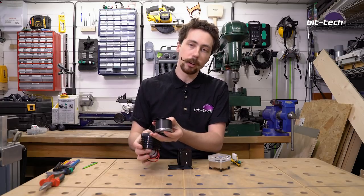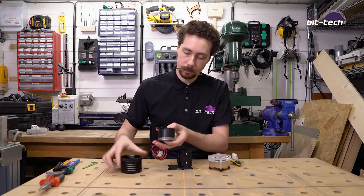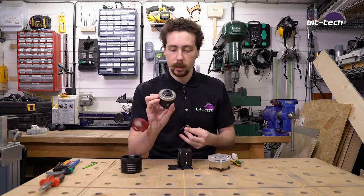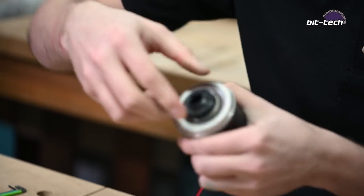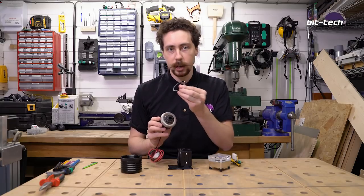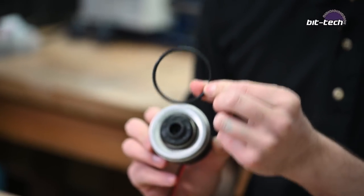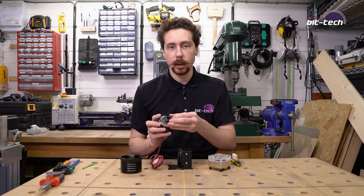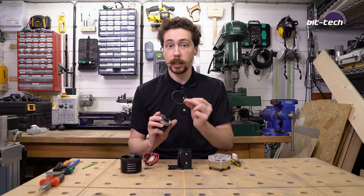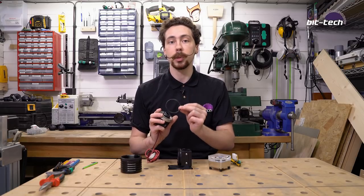All this housing here is primarily an aesthetic feature — we'll try and bundle the cables through the hole there. This is the pump itself and you have an impeller which connects like that, and an o-ring. There are going to be different sizes of o-rings; I think this is a 3.2 millimeter one that comes in this particular pump top. If you're working off an existing pump I'd recommend either buying a specific size that you know works or measuring one that already works.